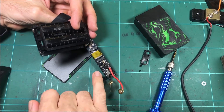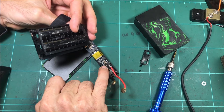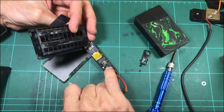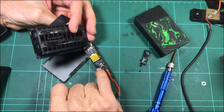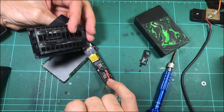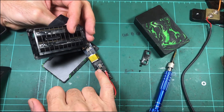So what had happened with this one is this little diode right here. It's a bit hard to see, but this little guy right here had completely fried. It looked like it had been soldered badly, but it actually had a big crack through it and the whole device had just lifted up off the board. So yeah, it wasn't soldered badly — it was just fried.